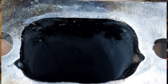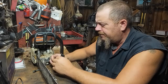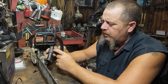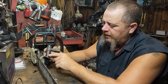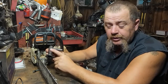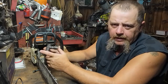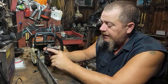We're pulling a little bit of fuel out into this — what we're doing is this here's pulling a little bit of a siphon. It's pulling a little bit of fuel-air mixture out into this pipe for it to be rebounded back in. You don't want too much. This all ran rich with this pipe — I had to lean it out. It actually pulled some of that air charge like a big tuned expansion chamber type pipe, not near as good, but in the same manner it pulled some of that fuel-air out into this pipe.